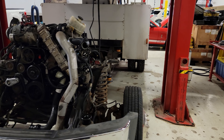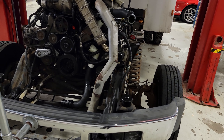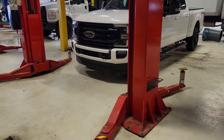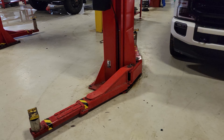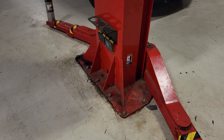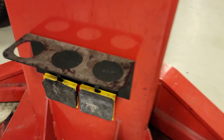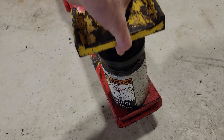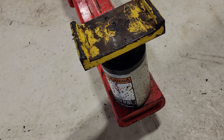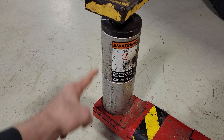These are my two money makers right here. I love working on the 18,000-pounders, but I usually have a couple of cars I'm working on flat doing non-hoist-needed repairs. These are set up like any other hoist — into the ground with studs fastened to the floor with nuts. All of our 18,000-pounders came with those. Keep them lubed so they don't freeze up. We have small adapters and big ones — some are two pieces put together, some are one piece — for the different heights of trucks.